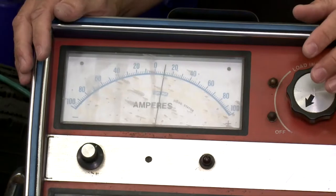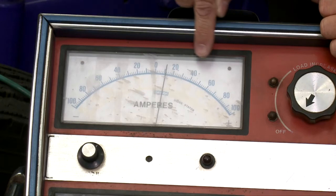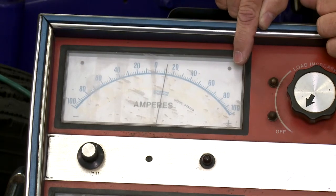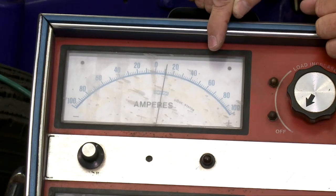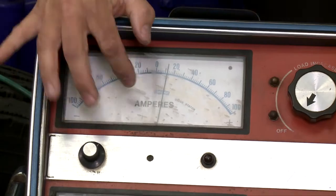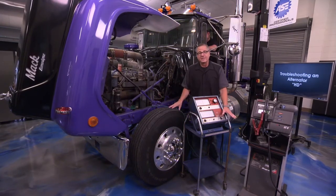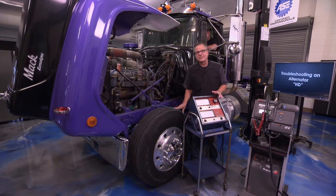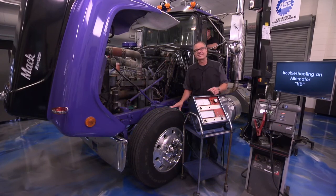It took a minute and I had to make sure the clamp was in good shape, but once we did, you saw it come down — it was putting out about 80 amps. That's good. You can see it slowly start to come back as the batteries get fully charged. Then when I switched to diodes, we watched that bottom indicator and we were in the blue — we knew we were okay. So with that we know our alternator is in good shape. You take these visual inspections with all these tests and you can test any alternator and troubleshoot any charging system problem.